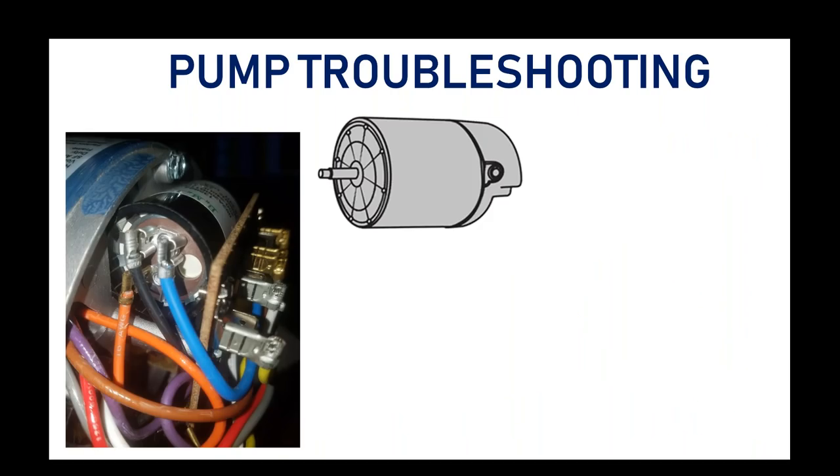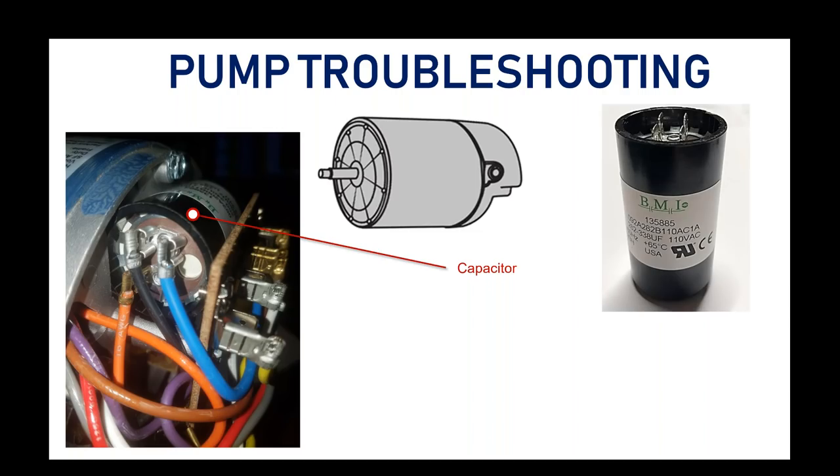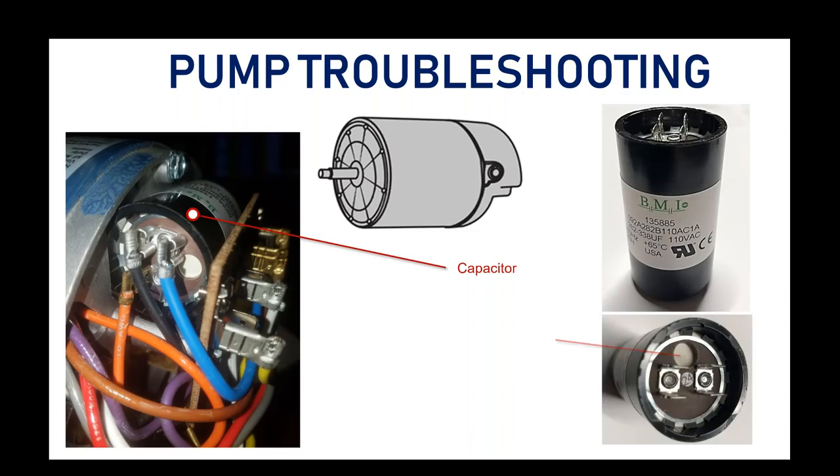The capacitor is located on the back side of the motor, mounted near the top. All these capacitors are made in America. There's a little white window visible when you flip the capacitor on its end. That's a good indication of whether the capacitor is any good — if you blow a capacitor, that window will vent and open up, and you'll get a black tarry material seeping out. That's a normal function of a capacitor — it vents in an effort to save the rest of the motor. A quick visual inspection of that window tells you whether it's shot.